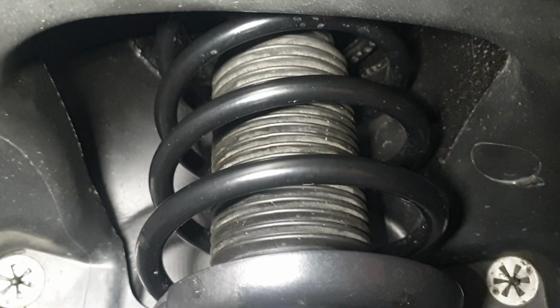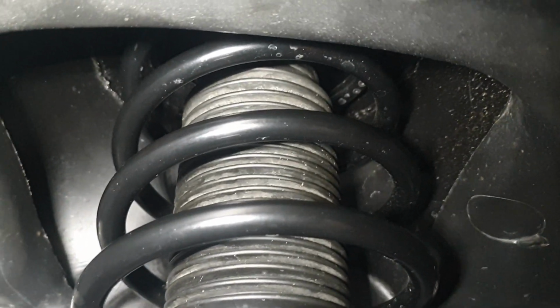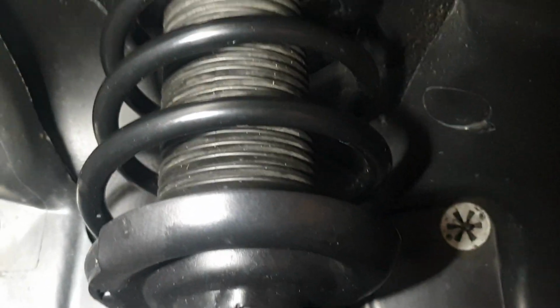Yeah, so that's where you want to be looking, right up in the suspension turret out there. Have a good look around either side where the spring's going up. That's what they call the suspension turret. You want to have a good look around that there. Either side of that, they've got plastic wheel liners, which most modern cars have nowadays. That's a little bit more difficult to assess the wheel arch. I'm talking about, because the wheel arch rots as well on these, as well as up in the turret.